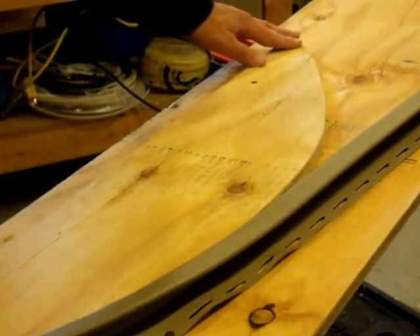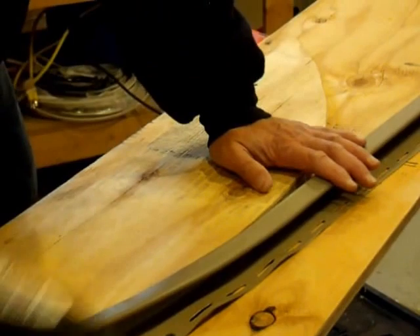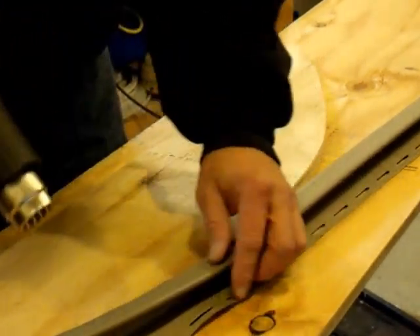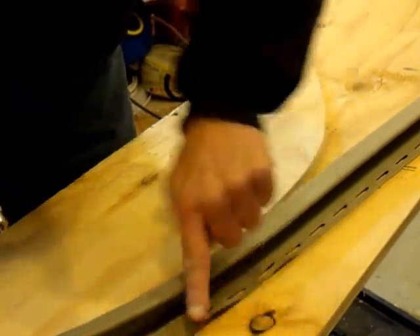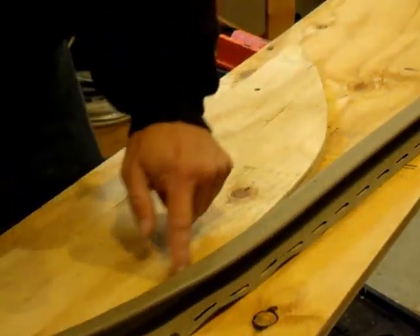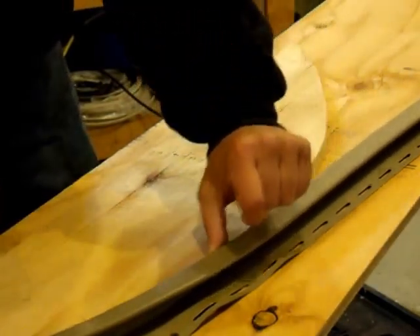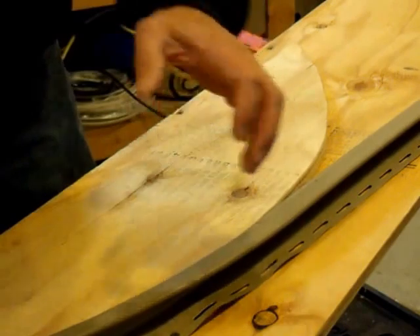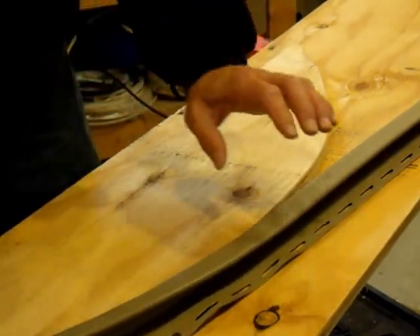So I made this form with the right shape. I've got the J channel and my heat gun. I'm going to put the heat gun on low and direct the heat on this flange and maybe a little bit on this edge. I do not want heat on the inside flange because when I get heat there, it softens things up and when you pull it against the form, it tends to buckle and you get goofy shapes.